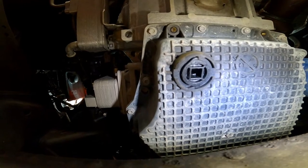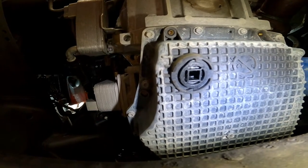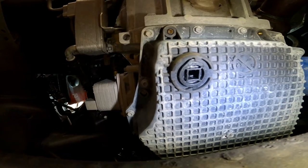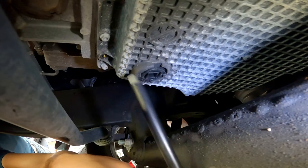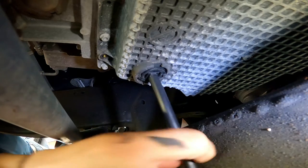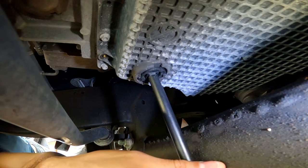It's not like a bolt where you've got to turn it completely out. All you have to do is turn it about halfway and that little plastic drain plug will come right out — you shouldn't have to put too much force into it. Just attach your extension on your ratchet, slide it right into the plastic drain bolt, and simply turn. Be ready that the oil is going to be coming out.